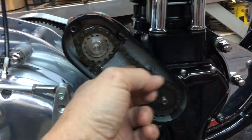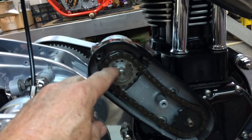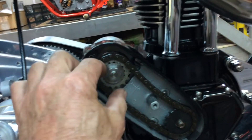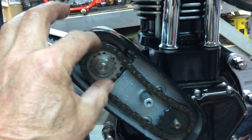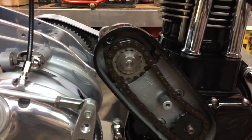I've got this nut off - see how this is too loose? I've got a new chain. This sprocket is actually adjustable, so I can advance the timing if I like. I can set the timing differently to factory. Normally that's just a fixed gear, but I've bought a special one so I can advance the timing and give it a bit more go.